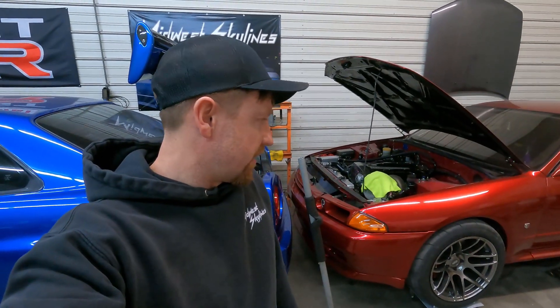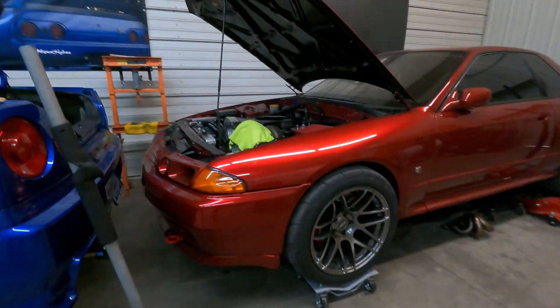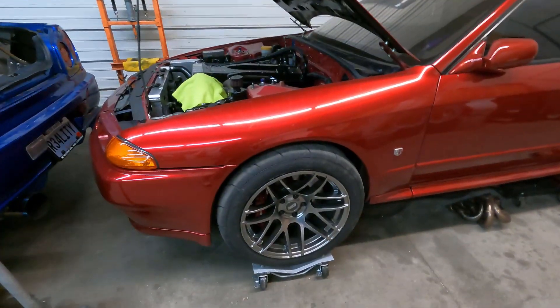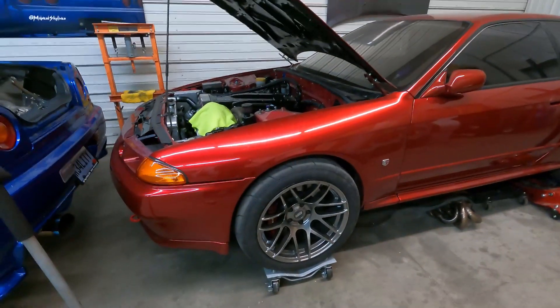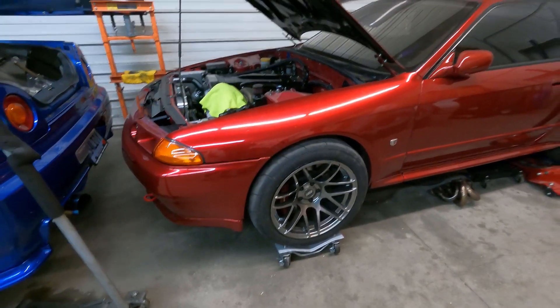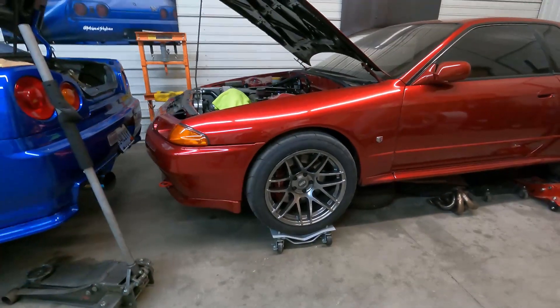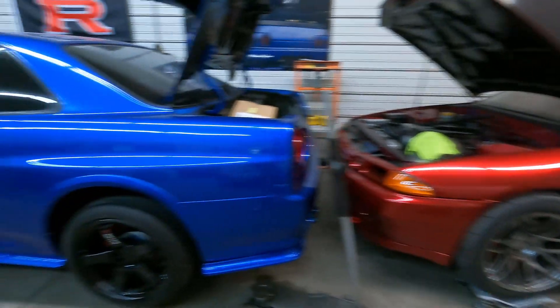A little update on the monster truck. I run an 18 inch wheel and a big tire, and it's not really working out very good for going super fast. Once you get past like a thousand horsepower, I need to run like a 26 inch tall tire — this here is a 27. So we are going to switch to something, I can't tell you yet but it's going to be nuts. These are cheapo ESR wheels — we are not doing that again. The next ones I bought are insanely expensive. We're dropping down to a 275-40-17, which should still clear the Evo brake setup. You guys wait until you see what I got planned for this thing this year. Yeah man, until the next one — we'll see you guys later.